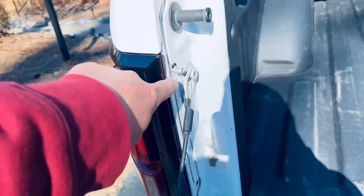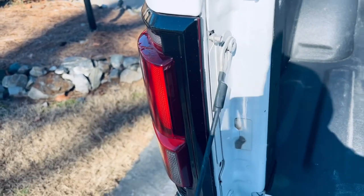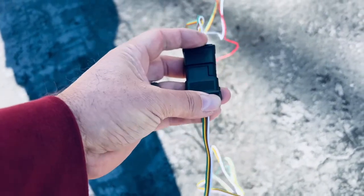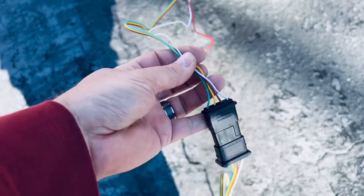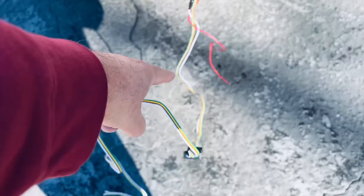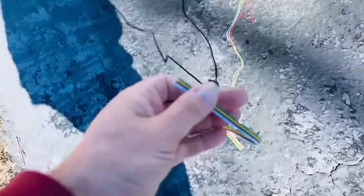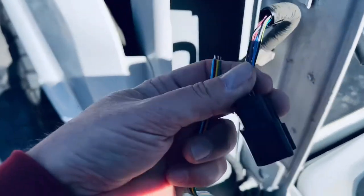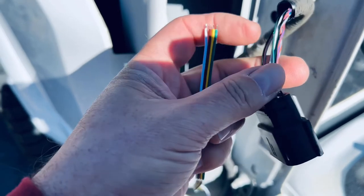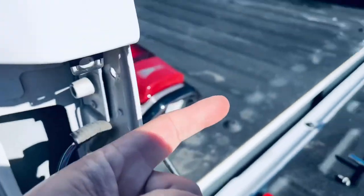Take an 8mm and remove the two bolts on the inside of the tail lamp. You can tap into the right or the left for the parking lights. On this connector I've gotten an additional connector so I do not have to cut the wires on the main harness of the MC Tuning light. The red wire dangling is the reverse/backup light wire. The other three wires we're going to tie into the factory plug — parking lights, brake light, and turn signal. For the other turn signal we'll have to tap into the other light.